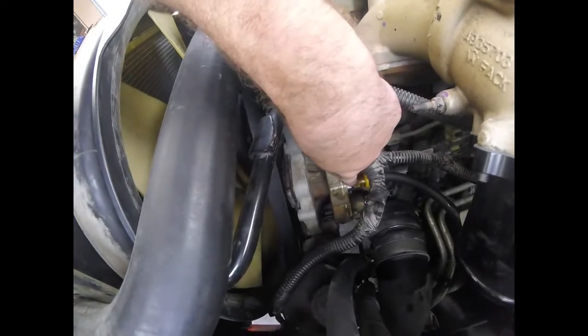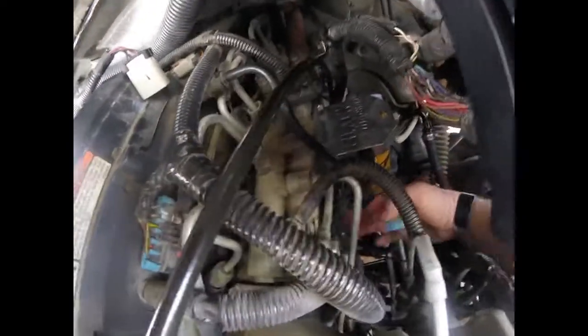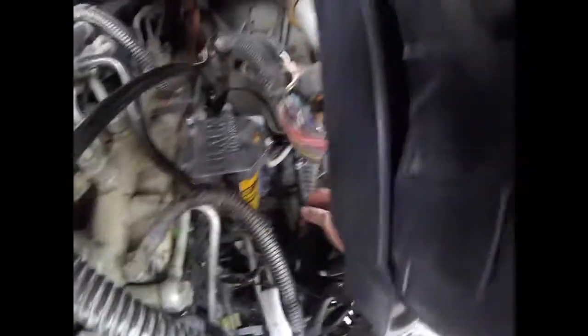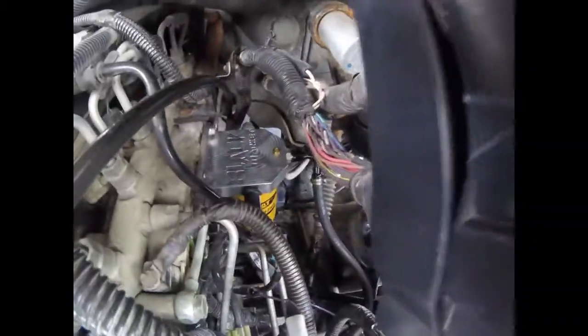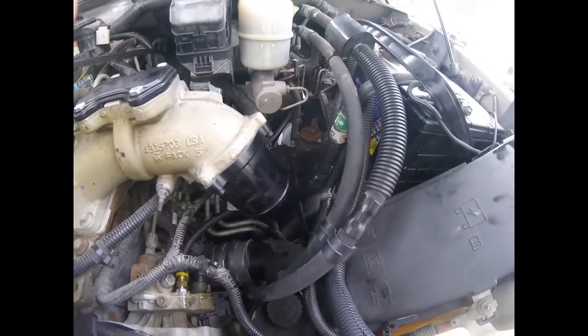So pretty much we're just about done. Just a last couple things to double-check: this screws in here — it's a 17 and an 18, make sure those are put together. This line from this banjo needs to clip on to that other end — it's a clip style that clips in to where this tube is. The fuel supply goes on the back. Don't forget to plug your water and fuel sensor back in. Here is your supply line — make sure that's tight, that's an 18. These are both 13s up here. This one will not clip into anything.